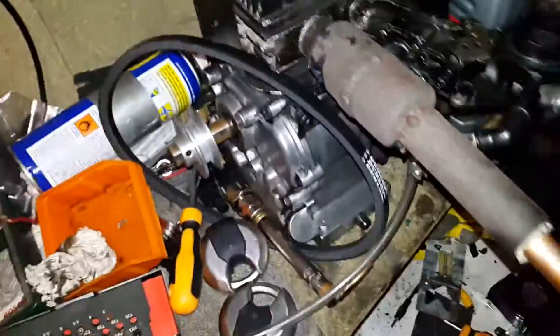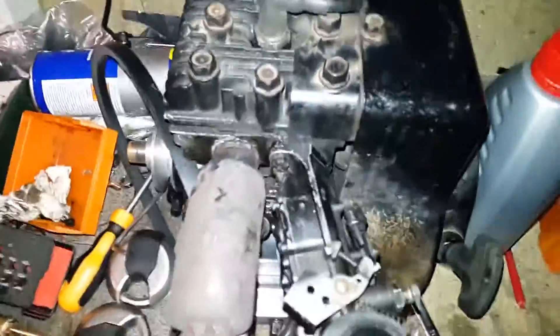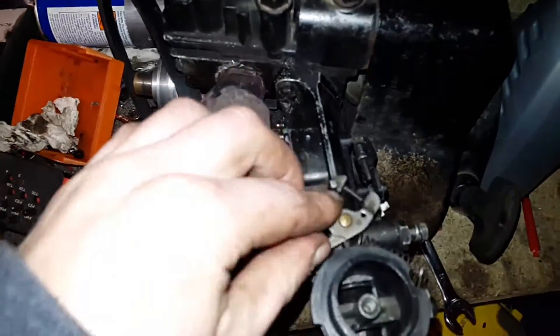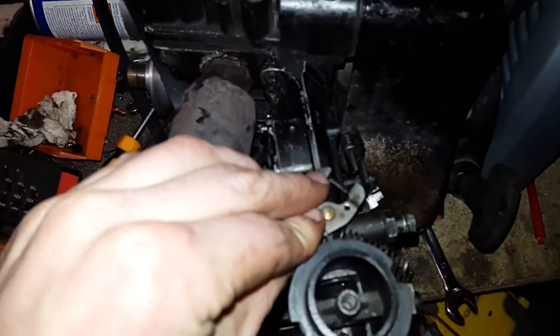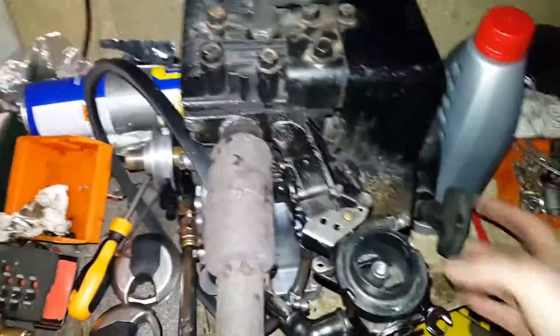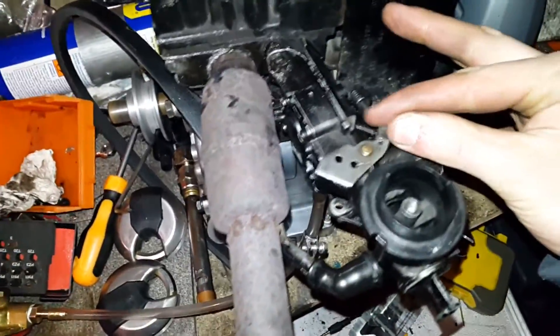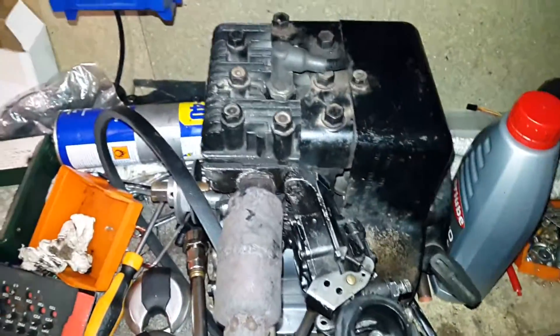So I'll give it a try and another start up. I will need a longer idler screw for the butterfly valve in there to hold it back a little bit, because it barely idles now but it sure revs up. Yeah, it just about shakes everything on the work surface, and judging by the sounds of it, it's working a lot more powerfully now.